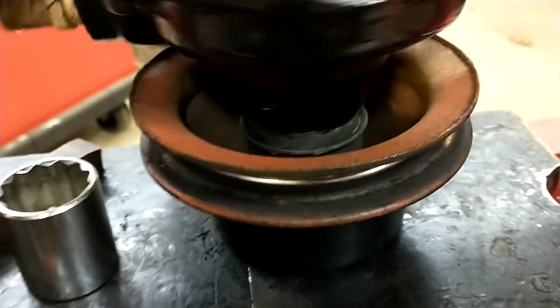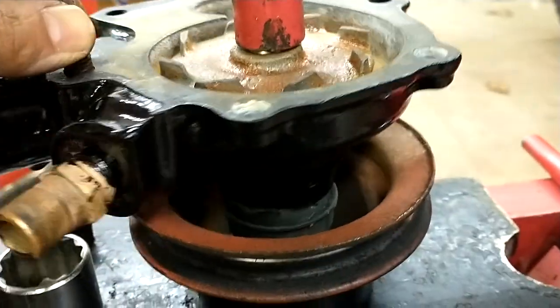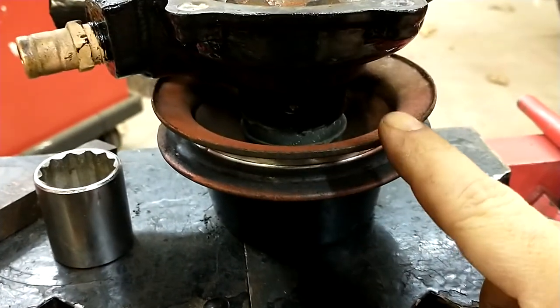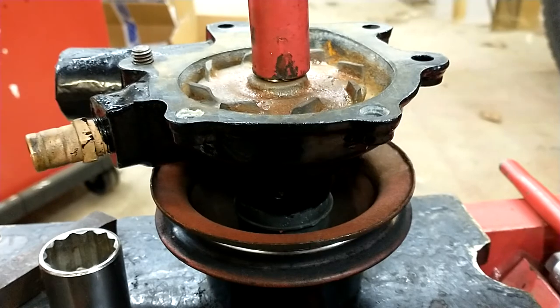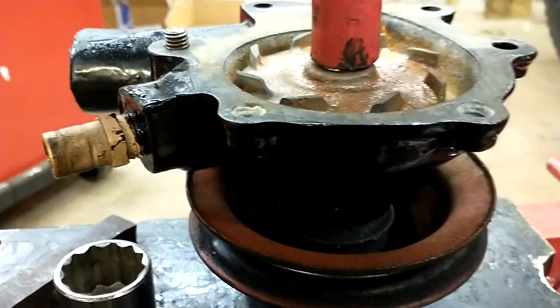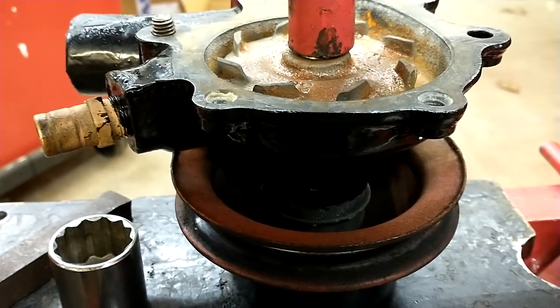It's not sticking. You can see it's still nice and smooth — all the pressure's just on the shaft itself. I think it's there. They give you a dimension that's supposed to be from, I think it's from here to here, or maybe it's the front of the pulley to here. It's like 4 inches and 9/32nds or something, so I'm just gonna give it a little more.